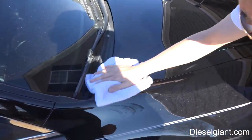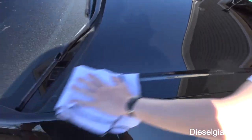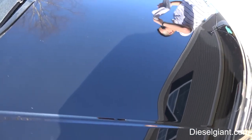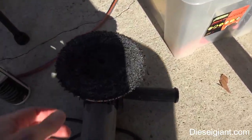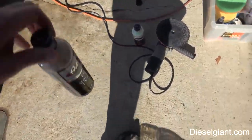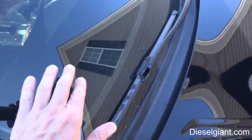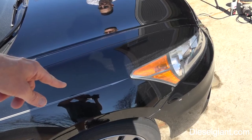What I finally did was use the microfiber cutting pad with Adam's Severe Swirl Polish Remover, and it did a really nice job. It didn't get everything out — we're not trying to get it 100 percent — but it removed probably 95 percent. Looks a lot better, feels better. That's what the microfiber cutting pad looks like. We'll follow up with the fine machine polish pad, then lay a coat of Adam's liquid paint sealant. When you use more aggressive polishes you get dust everywhere because it breaks down quickly. We're going to be doing the fenders and the hood.